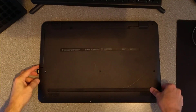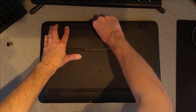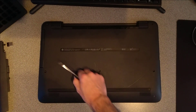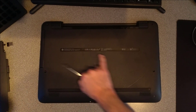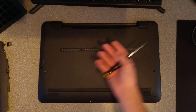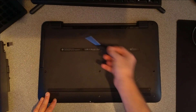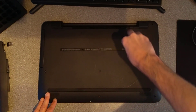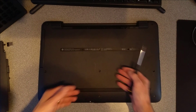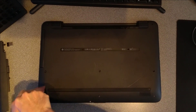First things: remove any USB adapters from the side and remove the battery. This will be destructive for the stickers on the underside — there are two screws you need to get to which are under the stickers here and here. You could peel the whole sticker up, but it's just going to be easier to go straight through the sticker and unscrew those two screws. We're now going to go around the rest of the laptop undoing all the screws.